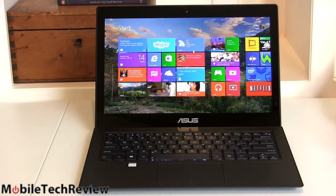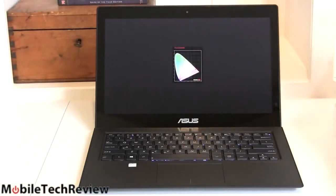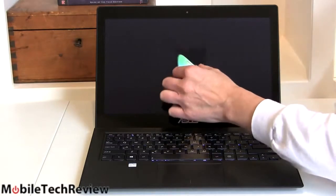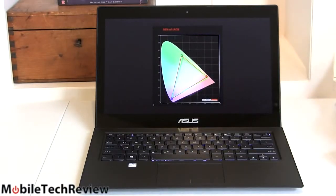How about colors? This did extremely well when it comes to color gamut. Adobe RGB at 79% — so far the top displays we've looked at, including the Samsung Ativ Book 9 Plus, Sony VAIO Pro 13, and the Duo 13, have been at 75%. So we've hit 79% here. Very good for Adobe RGB. Graphics professionals will appreciate the really high resolution display and the accuracy. 98% of sRGB — very, very good color coverage.